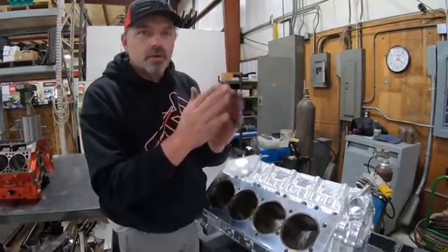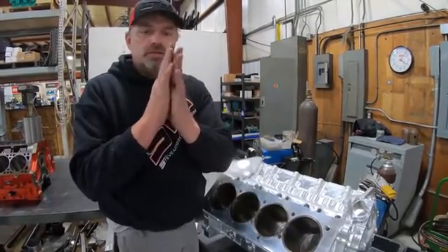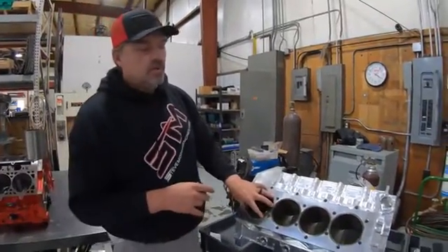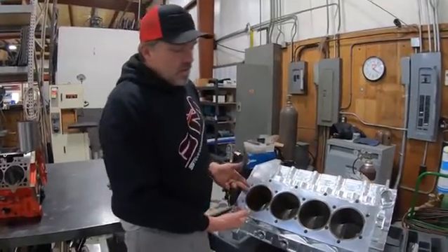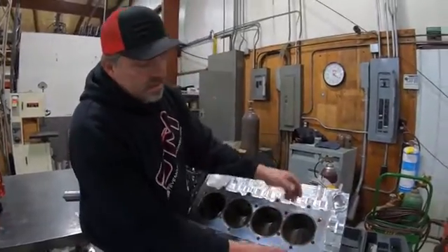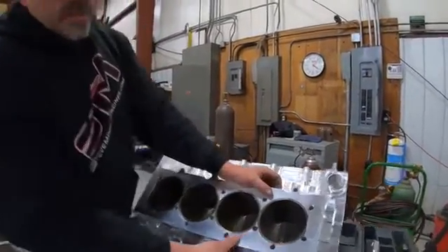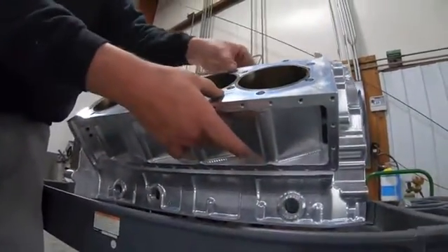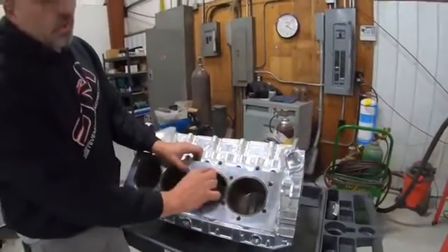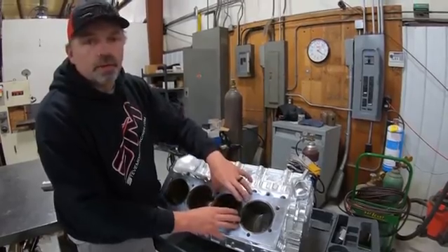With the mid sleeve, nothing is really pressed or locked together — it's just sitting there. In my opinion this SMX design is the best way to do it: no water through here, everything is solid, about three-quarters of an inch of deck thickness before hitting any water passage, and three-quarters of an inch total cylinder bore sleeve thickness all the way around. That's what it takes to put that sleeve in there properly.